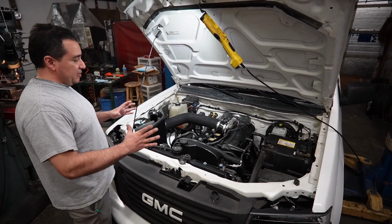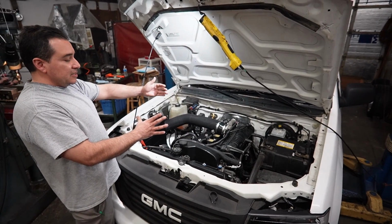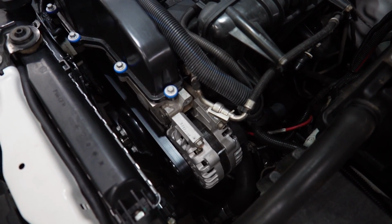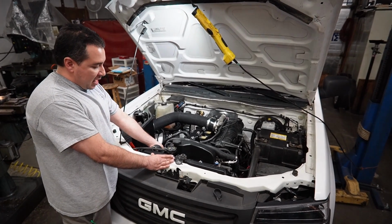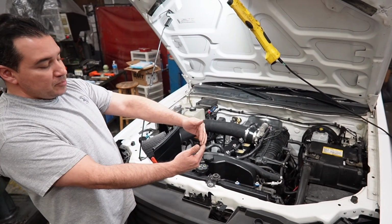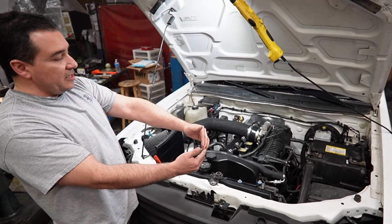So now that the motor mount's located, transmission stock location, we had to address the front of the motor, which would have been the cooling system. It's quite surprisingly easy to adapt. 4 inches closer, so now this upper hose had to be shortened. Well, the coolant outlet pipe was shortened 4 inches, which is exactly as much as you can shorten it without having to worry about anything. Lower radiator hoses are both donors. You just tee them together, make them fit that way so you got the right angles.